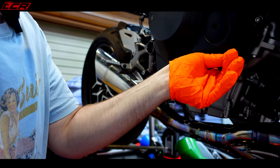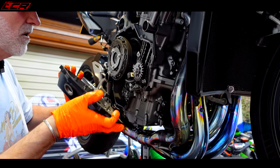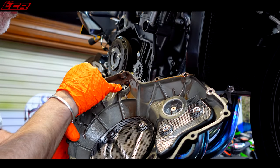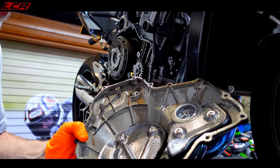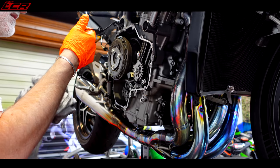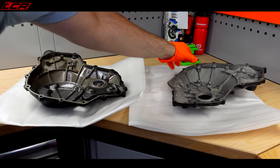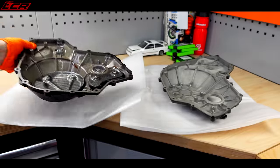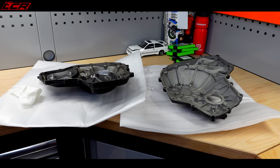I'm not just a pretty face, Mavis. Last bolt out — remove the casing. As you can see, you've got these soundproofing elements in there. They've also got the sight glass as well. The new one doesn't come with the sight glass; I can see it's got a circlip on it — I may not be able to get that out and may have to order a new sight glass. I do actually have a new gasket. There's certain elements to move over, but I'm going to start with the sight glass because I don't know if I'm going to be able to get it out. If not, it means ordering something else and that could take another two months to arrive.